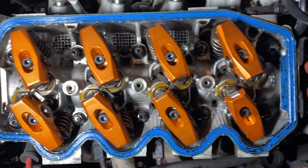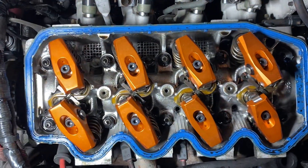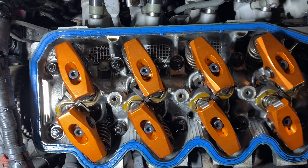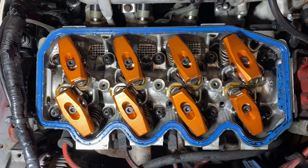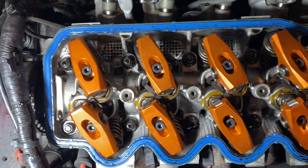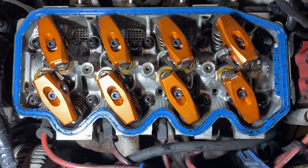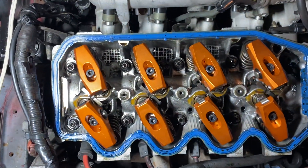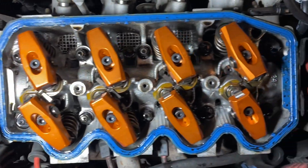In running mode, getting it warm — I haven't had a chance to do that yet. I have to take the battery home tonight, charge it, and I'll probably come back tomorrow and see if I can get this thing to fire up and run with these rocker arms on there, to see if they hit the valve cover or not. I keep hearing people saying they're rubbing the valve cover, but so far they have not — I've spun it over by hand and haven't gotten any marks.